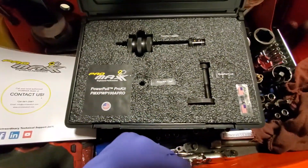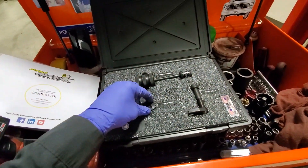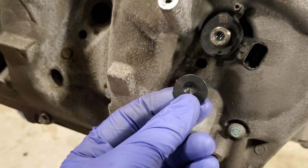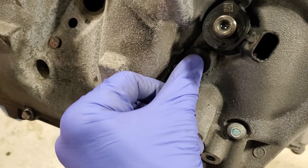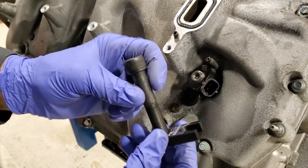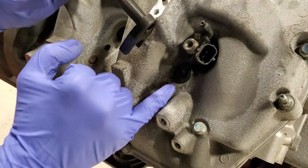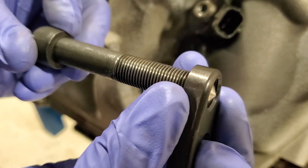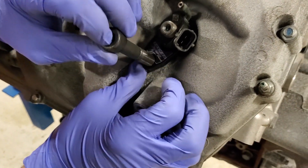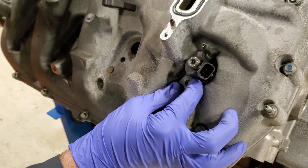Here's the kit — it's pretty simple. So what we're gonna do is first place this little piece in the injector hold-down bolt hole, so it looks like that. You know what the injector hold-down looks like — this is kind of the same thing. We're going to match that hole up with this end and basically just use that as the stop for the bolt.